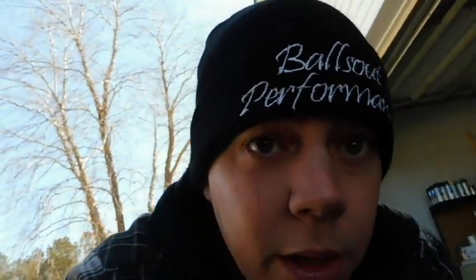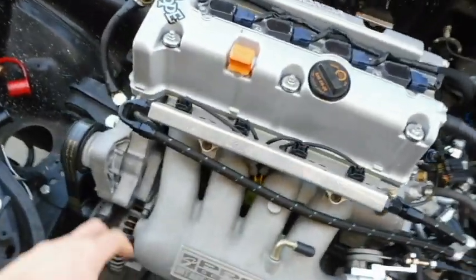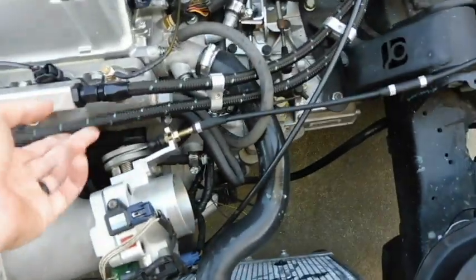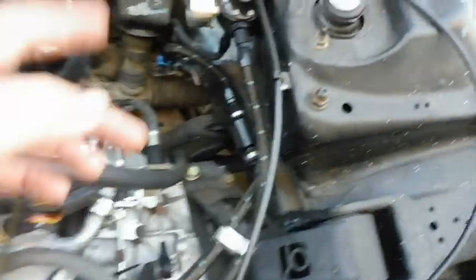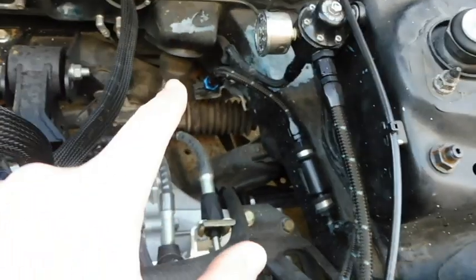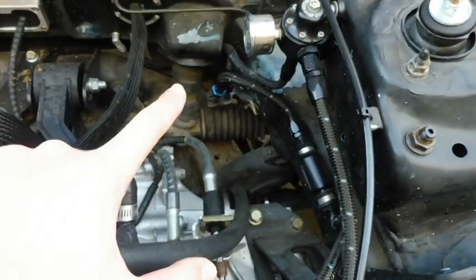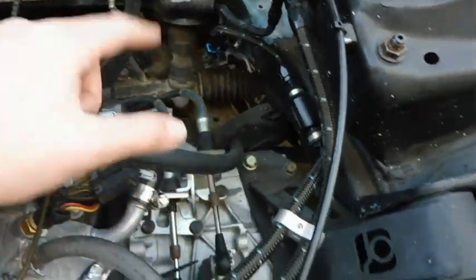Let's get into the next thing. At this point you should have the engine in and everything ready to go as far as the driveline and physically getting the engine bolted in. Next, let's talk about some of the accessories. Just using the standard K-Series fuel rail, standard injectors. I made these fuel lines out of Pro Classic with an aftermarket fuel pressure regulator, using feed and return. I converted the factory lines — cut and flared them with a 37-degree flare tool to accept AN fittings. I've got a small filter there.